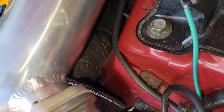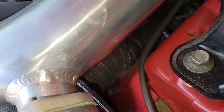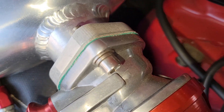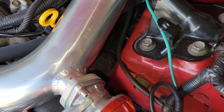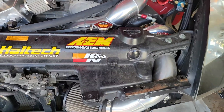That will dictate your clearance for your down-pipe between your strut tower and your down-pipe. As you can see, mine was basically kind of rubbing there. At one point I even had plans to cut some of this out so that way I could clear it, but luckily, after playing around with the exhaust piping, I didn't have to do that.